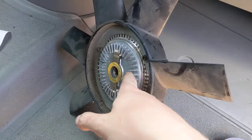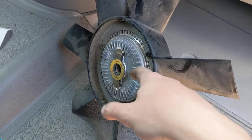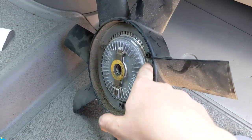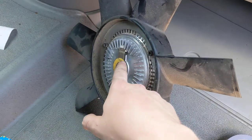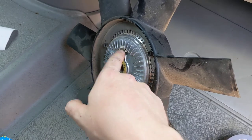What happens a lot is you'll see on a bad fan clutch — one that's failed in this way — a lot of residue, oil, and gunk around here, and it usually gets real thick and sludgy with dirt. That's a way you can tell if your clutch is not functioning properly.